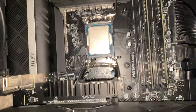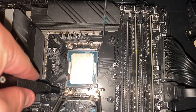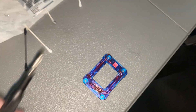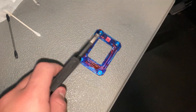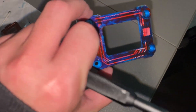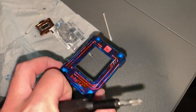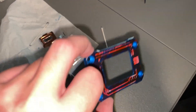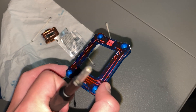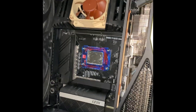CPU is in. Now it's time to replace the stock ILM with the washer mod with the frame. My frame is custom painted with TG Shield — just to make sure that if any liquid metal gets on it, since it says aluminum, it won't destroy it. This is also going to make sure that the CPU doesn't bend. I'm going to unscrew the current ILM and replace it with this one. The frame is now in. I have liquid metal on the CPU and liquid metal on the plate. Now I'm just going to put it back on, put it all together, and then we can fire up the PC.